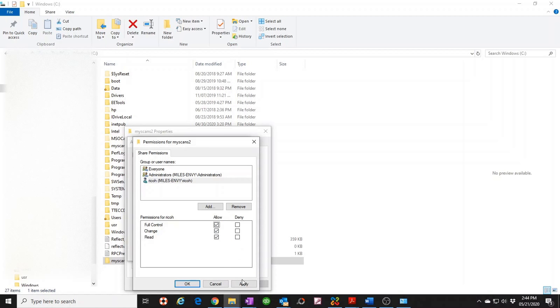Once you're in the web interface, click Login. The default username for all RICOHs is lowercase 'admin' (a-d-m-i-n) and leave the password blank, then click Login. If you can't get past that screen and it says 'failed,' you'll need to contact your RICOH service provider. They may be able to help over the phone, but most likely they'll need to send a tech to access the service section of the machine and reset the password.